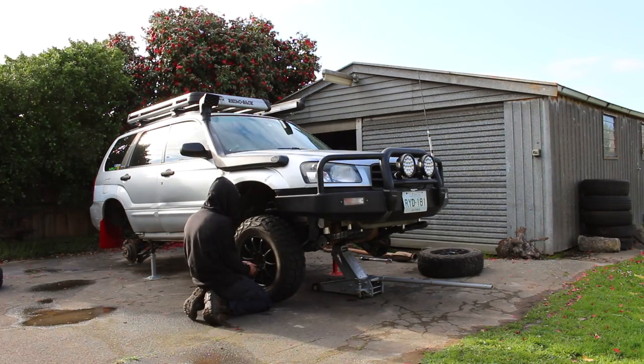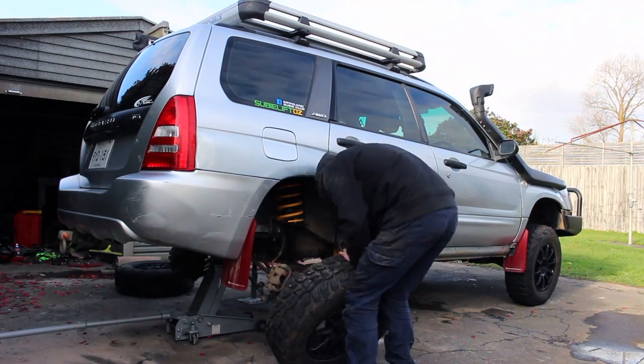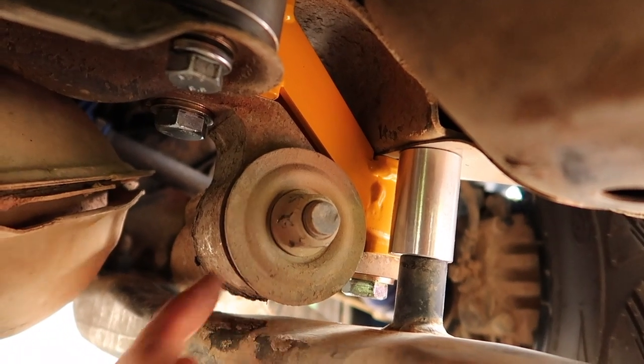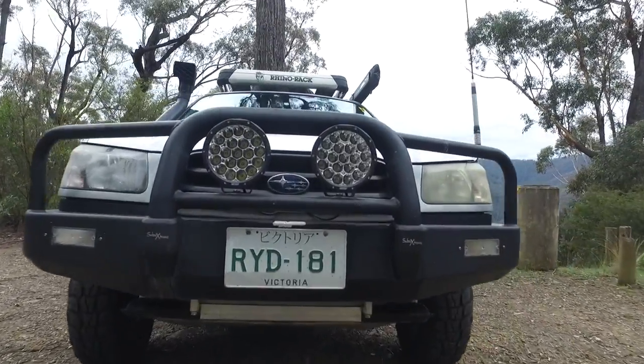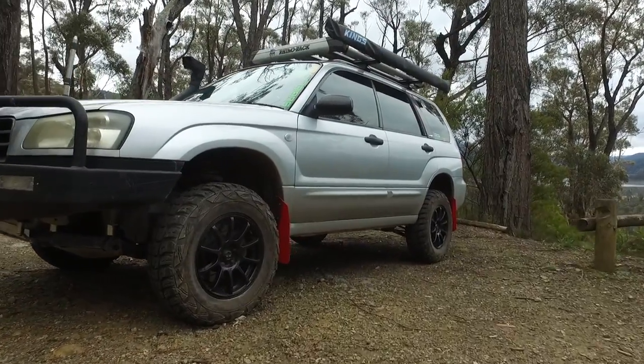Refit your wheels and lower your car. The last thing you want to do is tighten your front LCA bush nut as the bush needs to adjust to the new height and angle. And there you go - you just fitted a monster lift kit to your Subaru. Remember you still need to get a wheel alignment and get your exhaust modified.